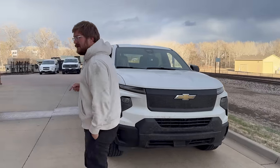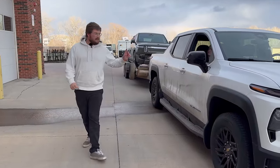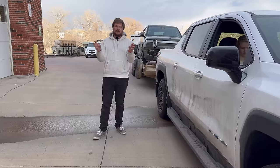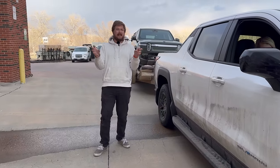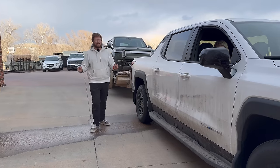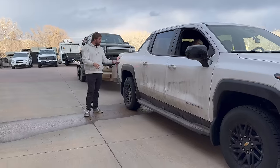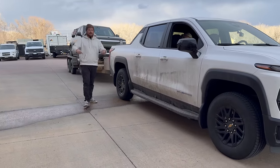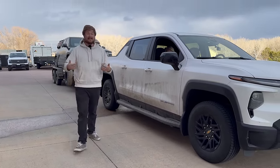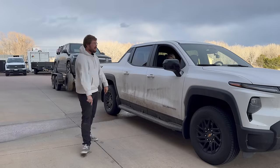We have dual motors in this particular one with a physical park lock. We'll talk about that throughout the drive. That was an issue with the Cybertruck, where the Cybertruck has an electronic rear parking brake that clamps down, but then also sometimes on steep hills can't hold it, especially if the brakes get hot. Here, it has a parking brake, yes, with a clamp on the disc brake, but also physical park locks, which should help in extreme situations, which this test is an extreme situation. And if we need to stop on a steep grade, I feel a lot more confident with this one.